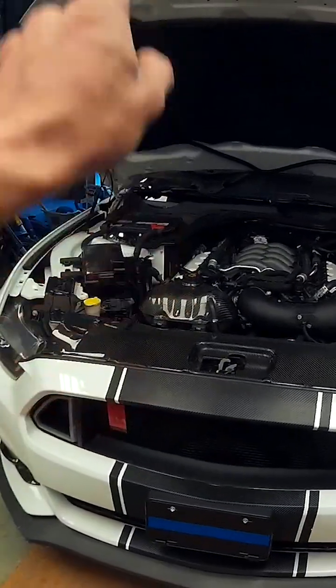So the next step: the dealership wants $10,500 for a new engine to put it in, probably $3,000–$4,000 labor. But this is Red Barn Builds. I think what we're going to do is yank that engine out, check out the bottom end — check the rods, see what's going on down there. If it's got a rod knock, check the crank, rods, and bearings — all the bottom end components. If it's not too bad, replace the crank, rods, and bearings, put it back together and throw it back in the car. Depending on what we find it might be completely messed up. But Red Barn Builds is going to try and fix her up. Go America!